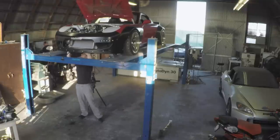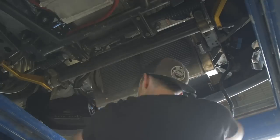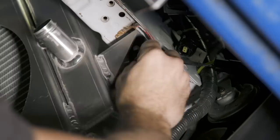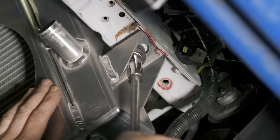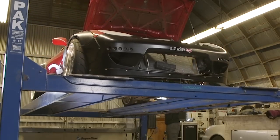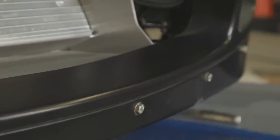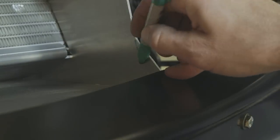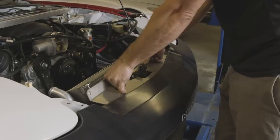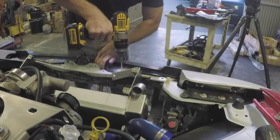So now let's get to work putting the new one in. First thing we're doing is test fitting. The radiator mounts to the chassis via ears welded to the end tanks with big holes to fit rubber isolators. These isolators prevent chassis flex between the frame rails from torquing on the radiator and possibly causing a leak. Since we're using the Rocket Bunny kit we're not sure it'll fit because the mouth of the car is a lot bigger. Part of the shrouding is hitting the front bumper of the Rocket Bunny kit, so we're marking on the aluminum where we need to clearance it. There are also holes on top that aren't in the Rocket Bunny kit that we need to drill through to access the chassis holes.